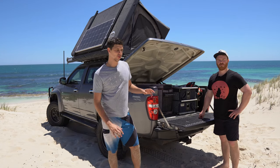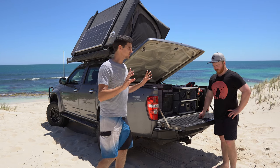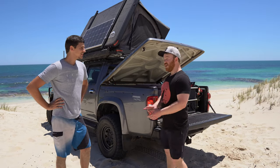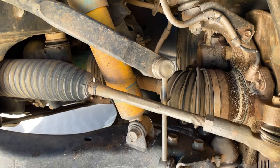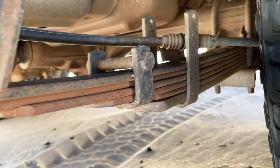That really goes to show what you can do with a factory tub - it's all about creativity. One thing I forgot to touch on was the suspension. So what have you done to fit these 32-inch tyres? I have a 2-inch Bilstein lift at the front and the back, and a 1.5-inch body lift just to help fit those tyres a bit nicer. And it rides nice and comfortably on the Bilstein - super soft.